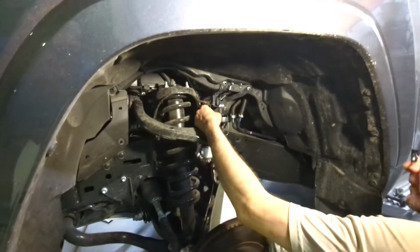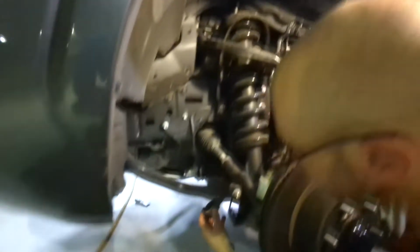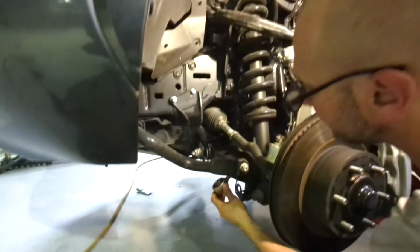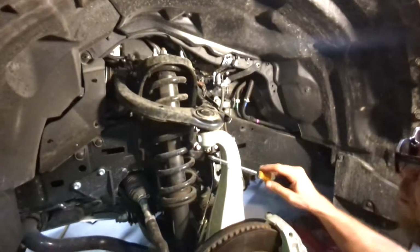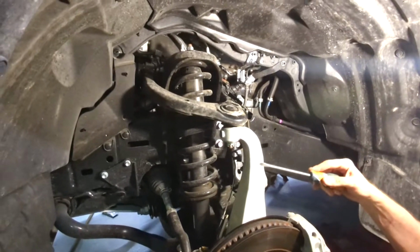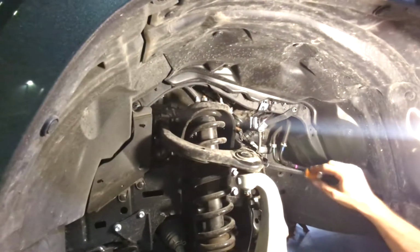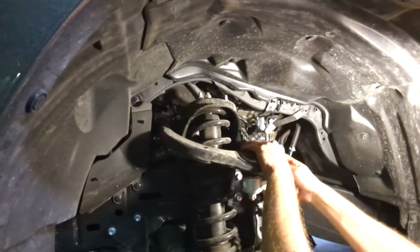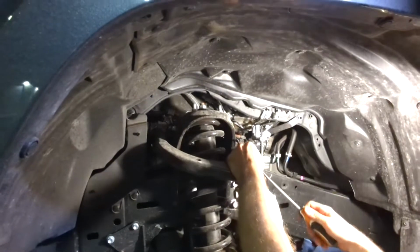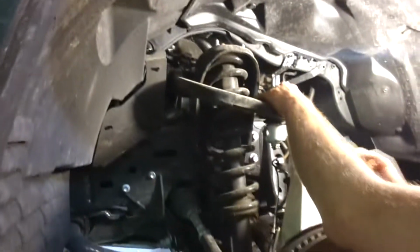So what's the sequence of opening? Well, we've already done the sway bar, because we needed both sides disconnected. Not really super important in which order, but we need to open the shock mounts, up and bottom. All the brackets first, maybe all the brackets for the brake lines and stuff, the brake line, the wheel sensor, so that they don't get pulled out too strong. So the UCAs are opened in the end? Yeah, once there's a little bit more space. Once the shock is out and everything, I can take care of the UCA.